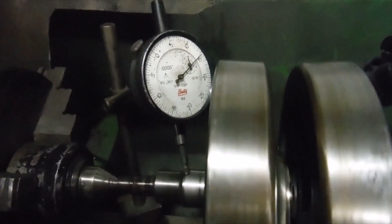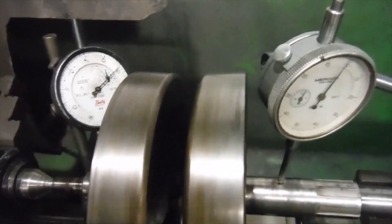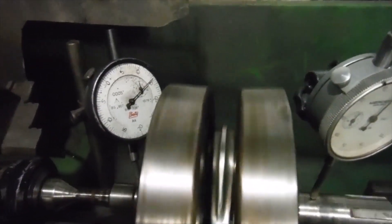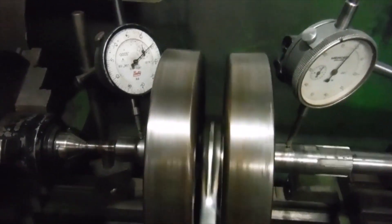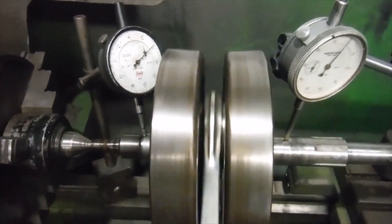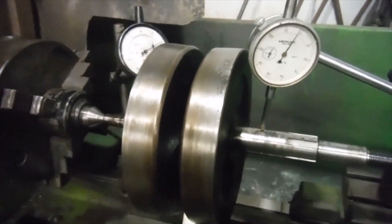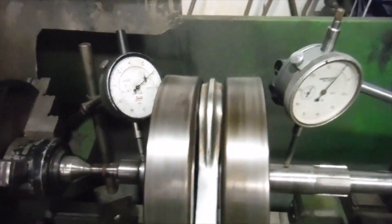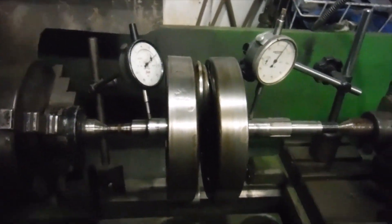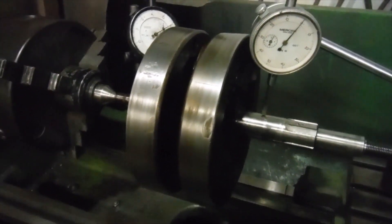They're not quite rising and falling together — almost in step but not quite. They're so close and those readings are so low I'm really not going to worry about that. To all intents and purposes we've got one thousandth of an inch runout overall from one main shaft to another. I really doubt that anyone's going to get much better than that very often — I've occasionally seen no runout, but it's very few and far between. This is up there among the best, and I'm very happy with it. The crank will go into the crank cases with new main bearings, the engine's going to get a full going over and tuning up, and that should make for a very good and long-lasting bottom end.